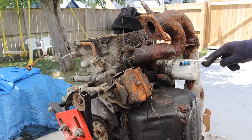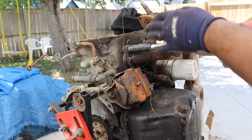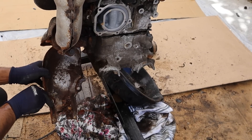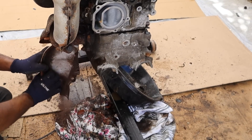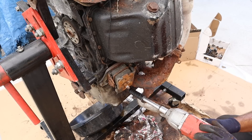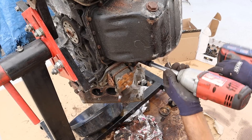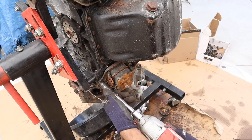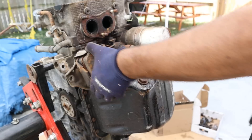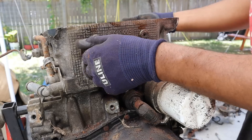Looking over on the passenger side, this is where the oil filter resides, along with the passenger-side engine mount. I'm going to remove all the 14mm nuts that hold the header. Over on the driver's side I'm peeling back the heat shield — wow, look at all the rust. With that out of the way I can remove the exhaust bolts on the driver's side. Now I should be able to remove the whole exhaust. While I'm down here I'll also remove both engine mounts. Lucky thing I kept that extra bolt in the head.